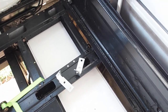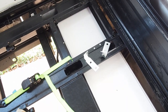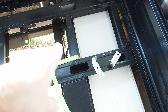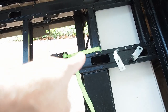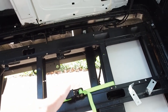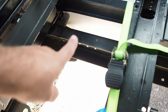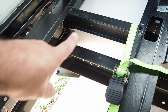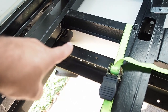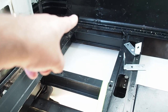I've been racking my brain over the last three or four days to work out how I'm going to do it, and yesterday I think I've worked out how I'm going to do it. I'm going to mount onto this main beam that goes all the way down the bus, and in between that main beam and this beam here there's a 40mm gap. I've got myself a bit of 40mm tubing which I'm going to cut to 600mm, which will take me to nearly the edge of the bus.